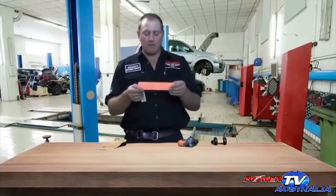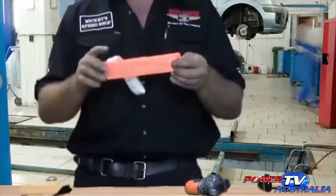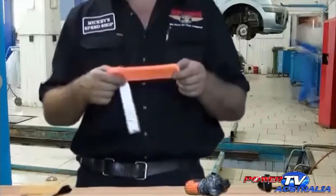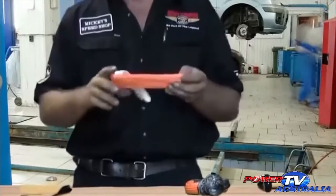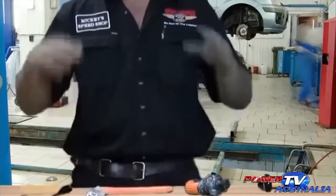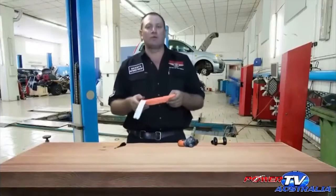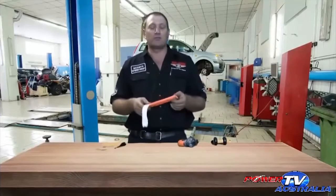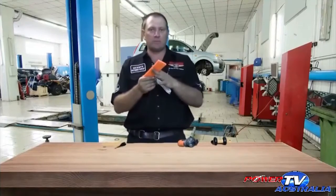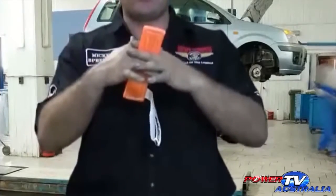A great product here is this device which is used to join two snap straps together. If you've ever been in a recovery situation where your 9 metre snap strap is just not quite long enough, you need to join two of them together. You'll see it quite often where they will get the two straps, loop them together, pull, recover the vehicle, and it's virtually impossible to get those two snap straps apart. This is where this device will slide in between your two snap straps and stop the tightening up and the pulling of those two snap straps together.